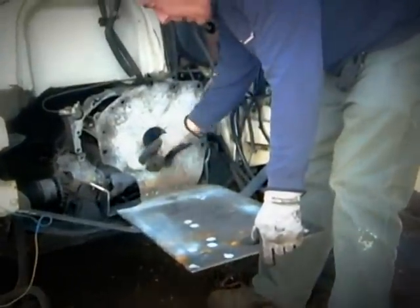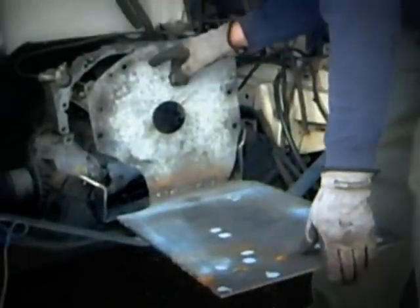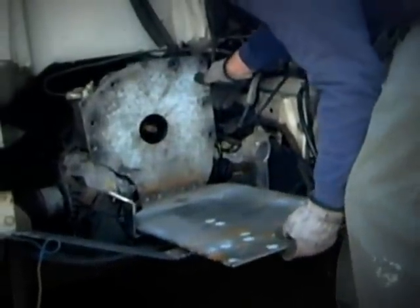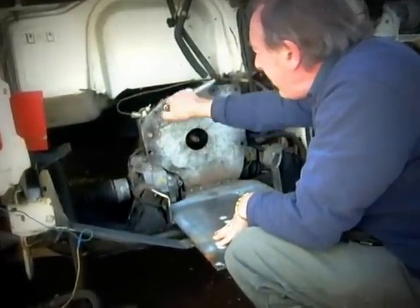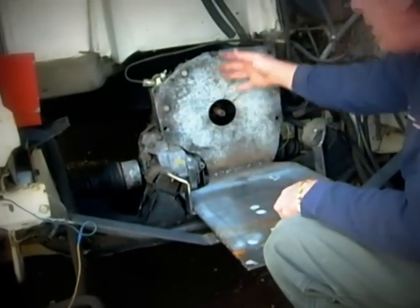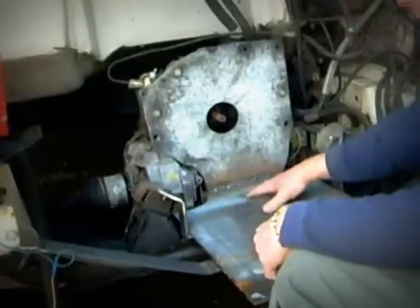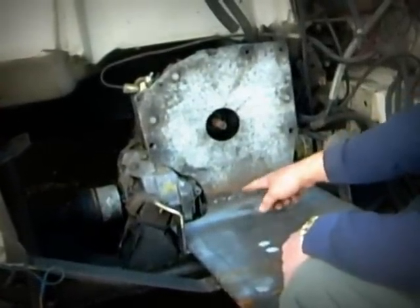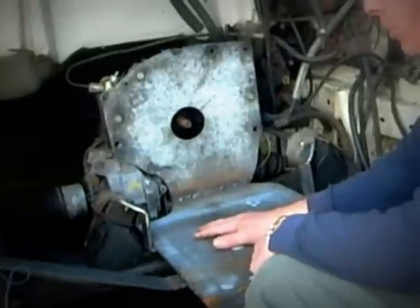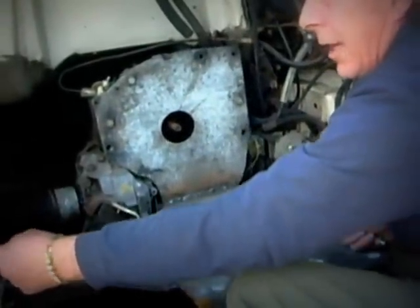As you can see, we've marked all this information out on this piece of sheet steel and welded it at right angles to this bottom piece here. If all is correct, this should line up — and look at that, what a surprise. We've got three bolts in just to get this mounted on the transmission casing. This bracket will now hold the electric motor. However, I don't think that this piece of sheet steel would hold the motor by itself — it would probably cause the welding to crack. So what we did was make a bracket to cradle this piece of metal on the bottom, then another cradle here, just welded it, put a couple of lugs on and bolted it to the chassis.